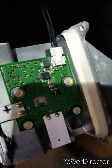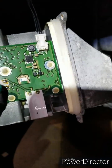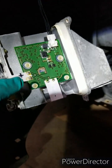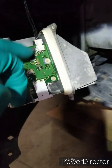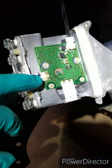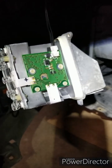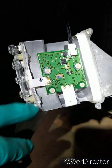This connector gives 12 volts to the electronics, and then it transfers to a higher voltage around here. So if your unit is not working and you have it out, you can switch on your indicator and measure the voltage on these two points. If there's no voltage at all, the problem is in the electronics or in this connection lead. If there is voltage and it's fluctuating — because it's switching on and off — and you measure above 24 volts up to 30 or even 36 volts depending on your measurement device's sample rate, you can assume the electronics are still fine and there's something wrong with the LEDs.